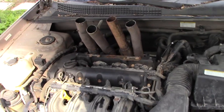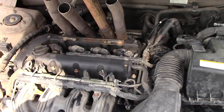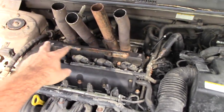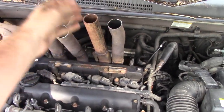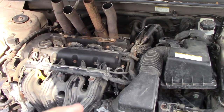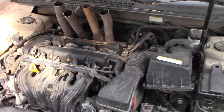That was 100% the problem. Some cars - Toyotas are notorious for this - if you have way too short of exhaust there's no back pressure in the pipes, it doesn't clear the cylinders well enough. The basics: by adding pipe, when the exhaust clears out of the engine it's sucked up out of the pipes. That airflow at each RPM is basically like a vacuum - it's clearing the chamber, putting in fresh gas and fuel. If you have a car with exhaust missing and it's running really rough at idle, you can hear the engine searching, going up and down - that's one of the first things to look for.